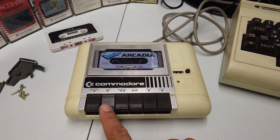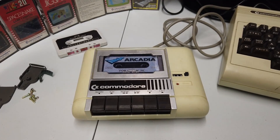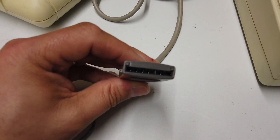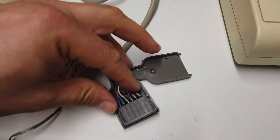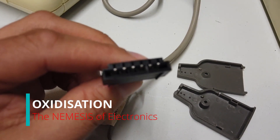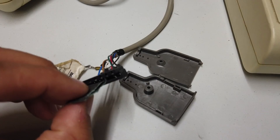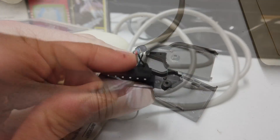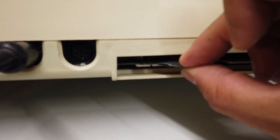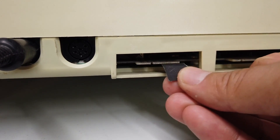When we press play on the VIC-20 tape machine, quite literally nothing happens. Let's go for the least path of resistance and check out those cables first. The plug itself is quite literally just an edge connector, and a typical problem with these types of edge connectors is they can suffer from a little bit of corrosion over many years of neglect. First thing to do is get in here with a little bit of folded emery cloth and just insert it between those pins and very carefully give them a little rub. The next part of the mission is very similar — it's just a case of carefully rubbing those contacts on the edge connector PCB.